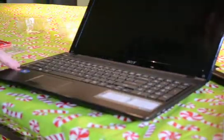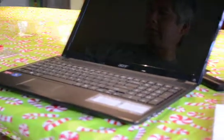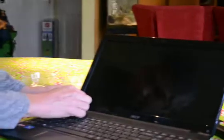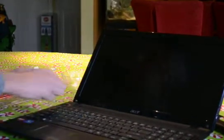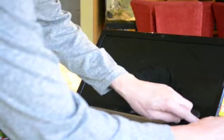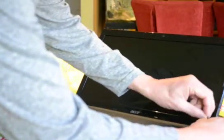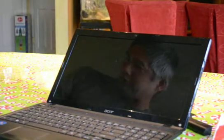What we want to do is remove the two screw covers in the bottom left and right corners. You can use an X-Acto knife or a sharp screwdriver to remove them. They are held there by a little bit of sometimes pretty strong glue, so you'll probably end up buggering them up. You may have to ask the manufacturer for replacements, but if you don't care how they look, you can just reuse them.